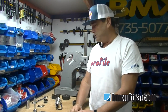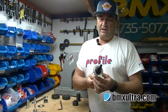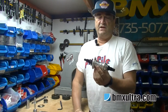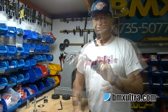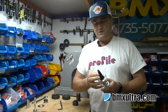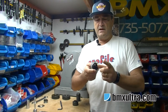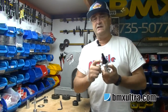The first one we're running today is the good old Profile Mini Hub. There are a lot of different configurations with Profile. This one here is set up as a street hub with a 14mm GDH gun-drilled hollow axle, which is the latest axle Profile has brought out after years of development. One of the fairly new features they've incorporated is an internal Allen key hex head fitment in the centre, which makes it a lot easier to get the locking nuts off.